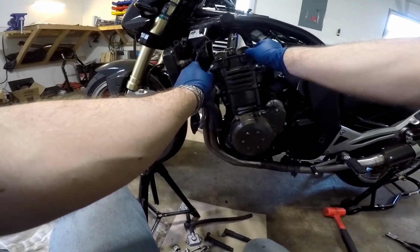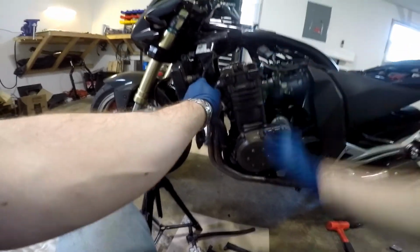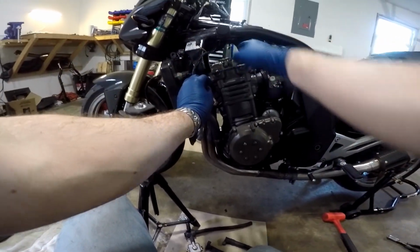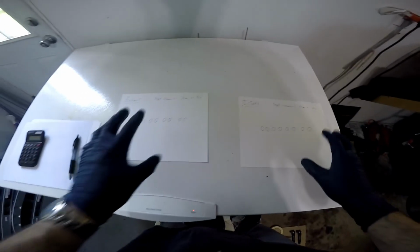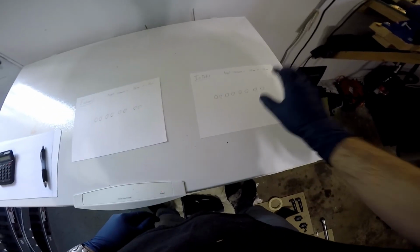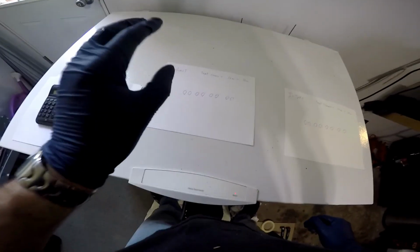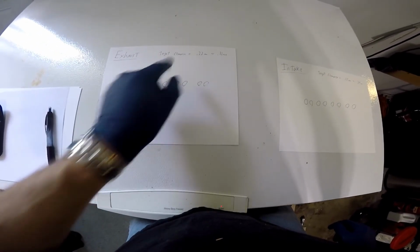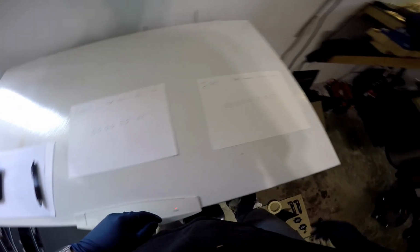because the target gaps from the intake side to the exhaust side are different. The intake side has a smaller gap. The exhaust side has a larger gap. And if you zigzag, you can get your math all messed up. So the best way to do this is to make yourself two sheets. Make an intake side sheet and an exhaust side sheet with the target clearances written on them, from the service manual, and I'll put those in the description as well.